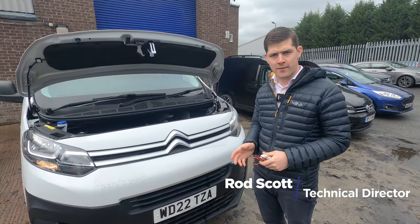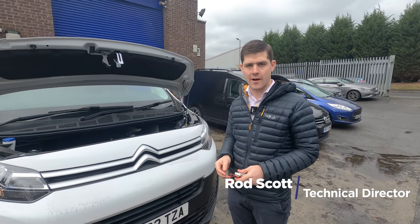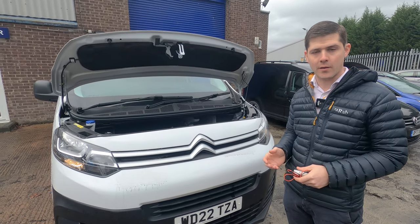You might identify that your battery is flat. With the engine running, the voltage should be at least 13.5 volts on your controller. If that's not the case, you obviously need to identify the problem.